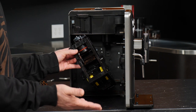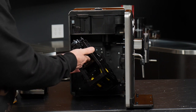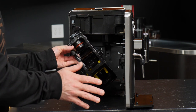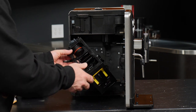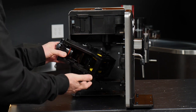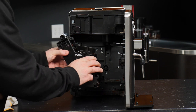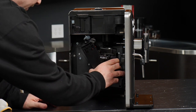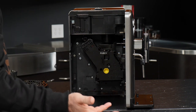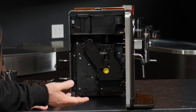That little brush can also help with cleaning. One thing to note: don't use paper towels or cloth towels, because those fibers can collect on the parts. Simply wash it off and let it air dry overnight before putting it back in the machine. You can also see the tracks where parts of the brew unit slide — that's where you would apply the brew group lubricant. To reinsert it, line up the corners with the two tracks and push it in. You'll know it's successfully reinserted when you can no longer remove it by simply pulling on it — you'll need to press the push tab again.